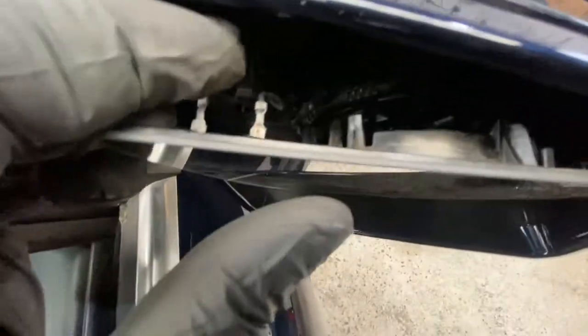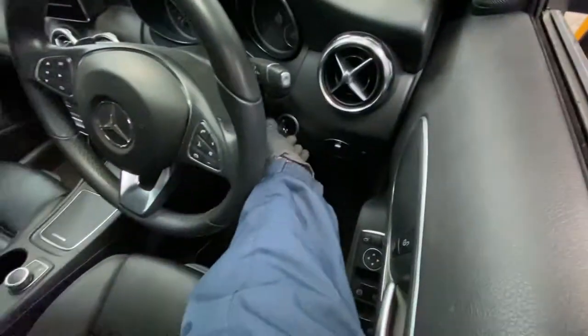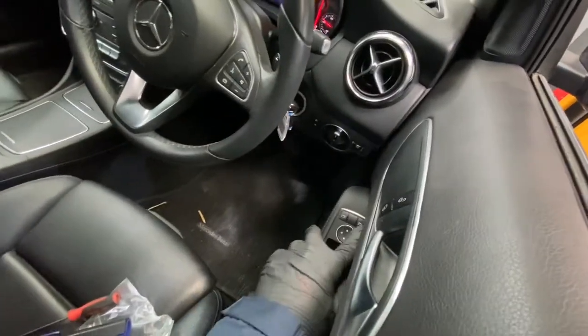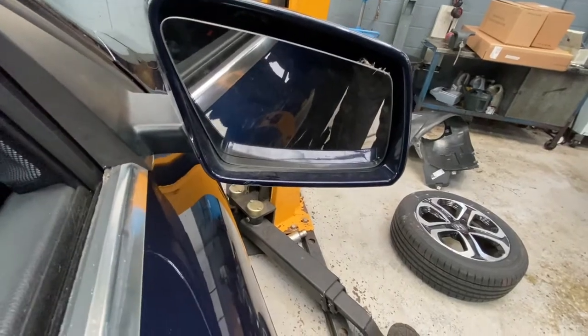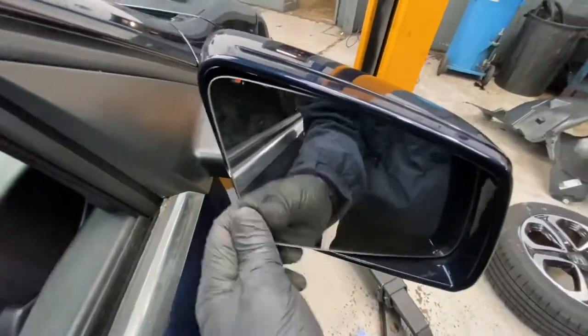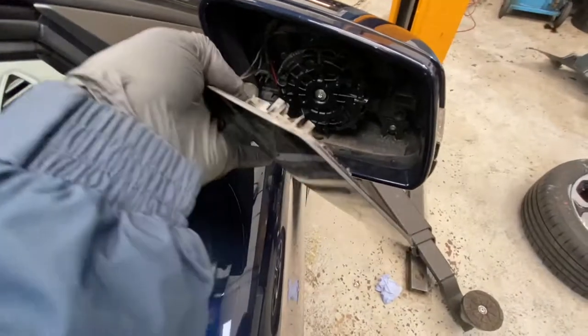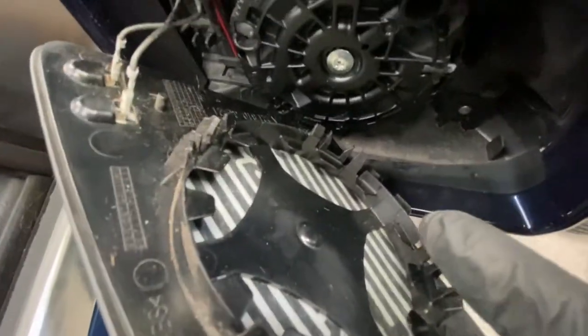As you can see it's coming off — there's some hooking at the bottom as well, let's hook those too. These are the clips I'm talking about that clip onto the motor that's situated just there. If you can't get it off like that, you can turn the ignition back on, go to that mirror, click on the right mirror and press up to send the motor up a bit, just so that you can actually take the glass out. And there — that's the glass off. As you can see these are the little clips — there are a few of them that go around and they've got a little hook on them that hooks onto the motor.